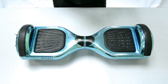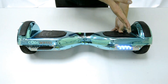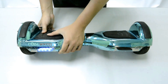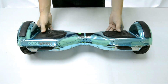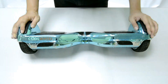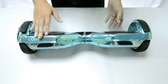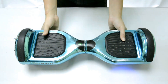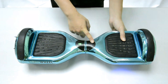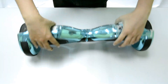The next step is an initial check on the lights. When we press the right pedal, the right light is on; when we press the left pedal, the left light is on. There's no problem with the lights. These lights are linked to the sideboard, so we can expect the sideboard gyroscope board is fine. When we press on the pedal, the indicator light should be on, but it's off — high probability the main board has failed.